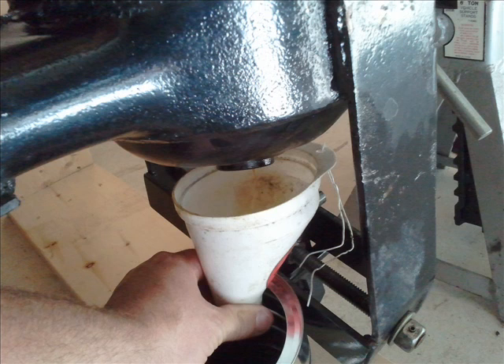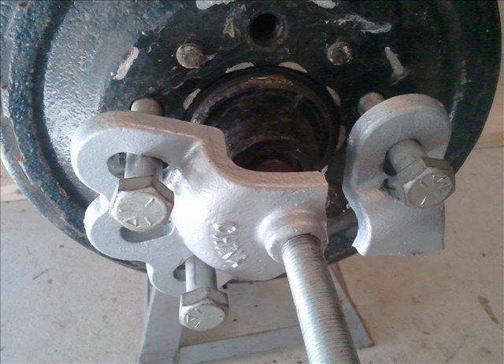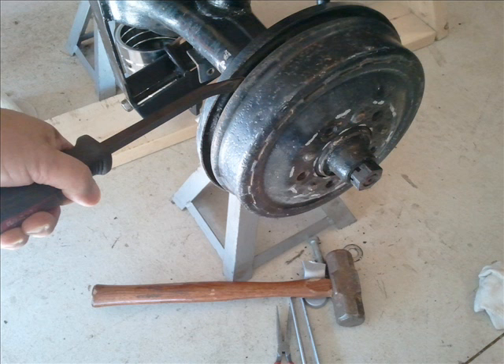There's another video that shows the sequence of taking the rear end out, but I'll review it here as well. This is an axle puller, or a brake drum puller more specifically, but as you'll see in the next picture, they don't work too well — this one broke, Chinese casting. So I did it the old fashioned way: I pried very easily between the brake drum and the back housing.